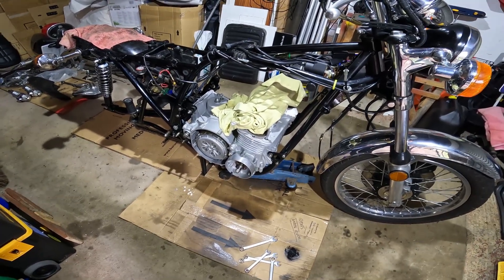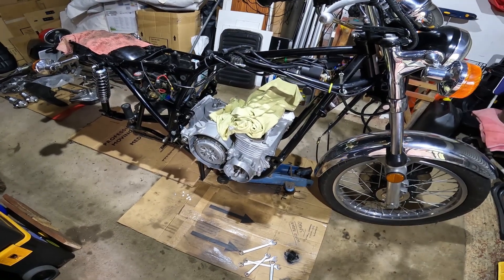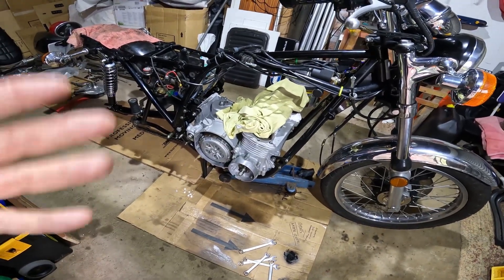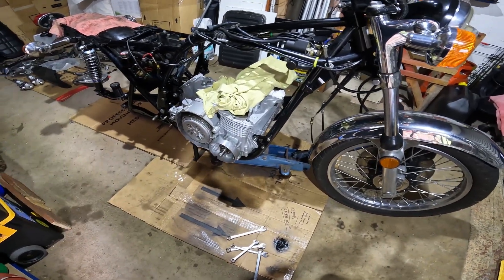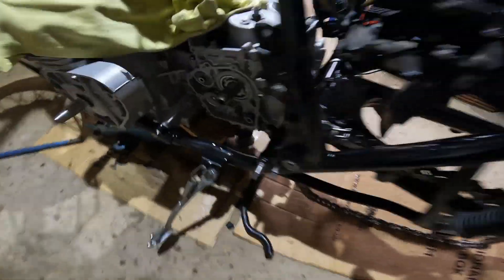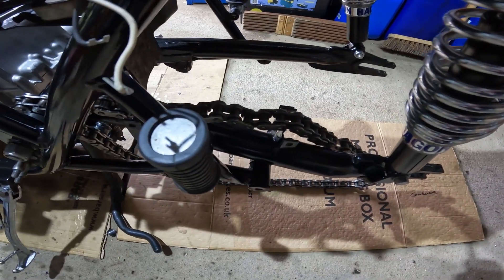It's slowly coming together. It's harder to get that engine in - believe it or not, even though this is a 900 - than the 1100. The 1100 is a shaft drive and you get a lot more room around here. Even though it's heavier, it was easier because of that extra room. As you saw on the previous video, we had to get it in exactly the right position to line up with the mounts, then once it's on the jack you can put those bolts, nuts and brackets in place to hold it temporarily. The jack now isn't doing anything - it can come away. I'm going to work now on the wheel - I want to get the wheel back in with the new sprocket and chain kit.